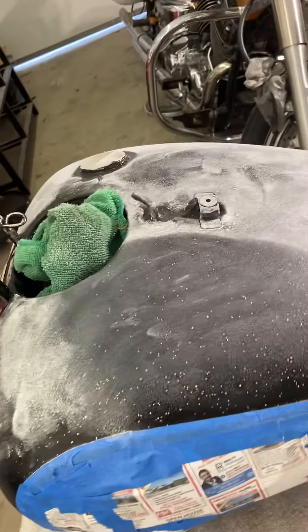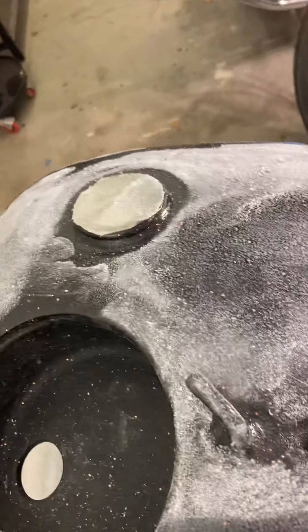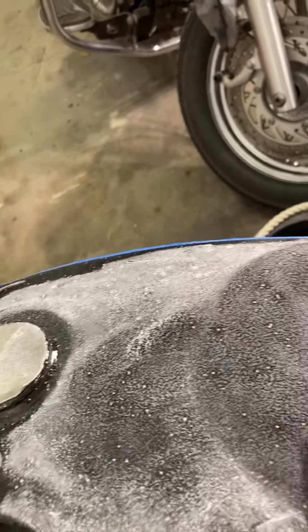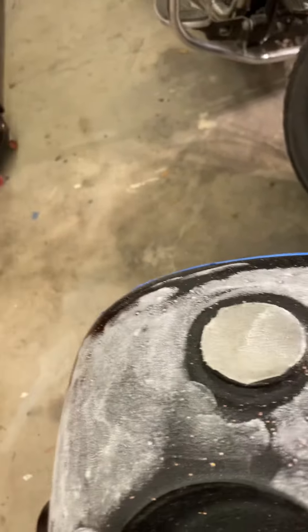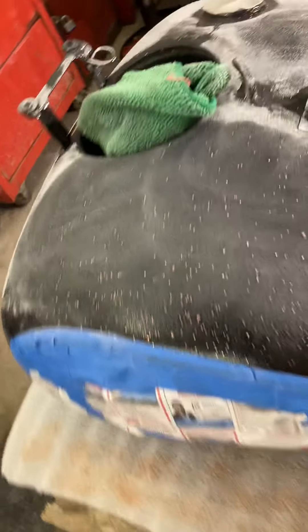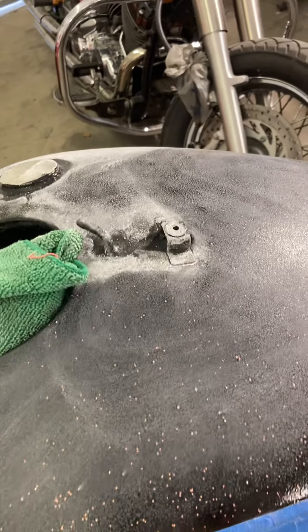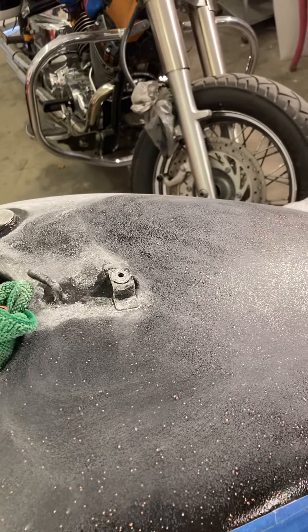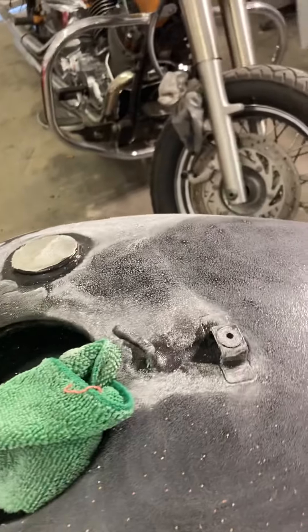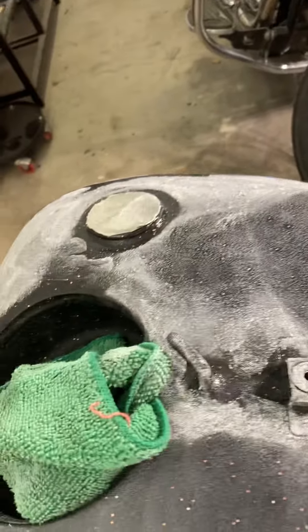Good morning guys. I want to start this video on what I got going on and keep you guys in tune with what can occur. Since this is kind of a learning channel — how people can get ideas on how to do things — when I shot my clear coat, things occurred. It all depends on the area you live in. Where I live, it's like 100 to 110 degrees almost every day. In clear coat you have your hardener, and you can get slow hardener and fast hardener. The only one available at the time was a slow hardener, so I want to tell you the difference between those products and how they can affect things.